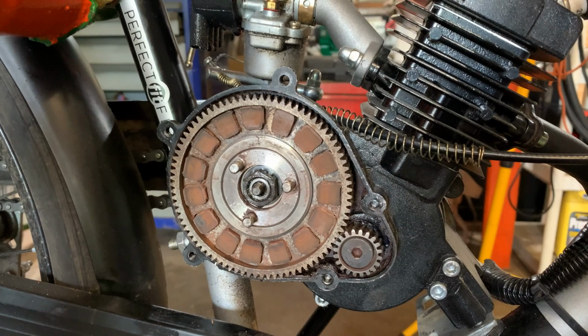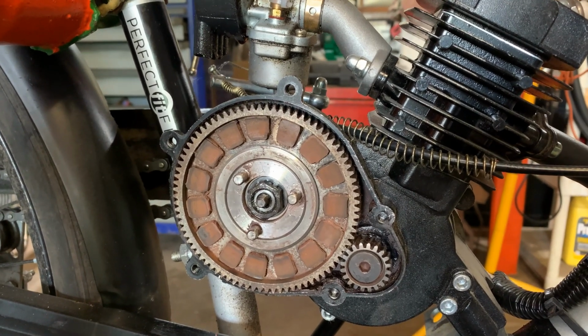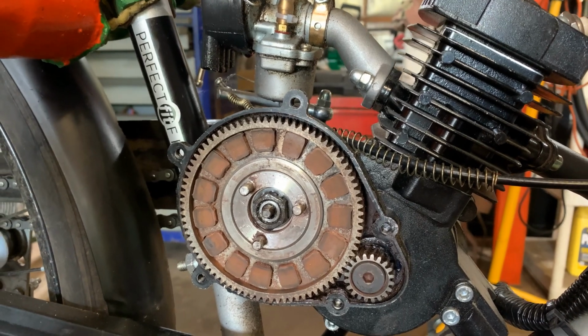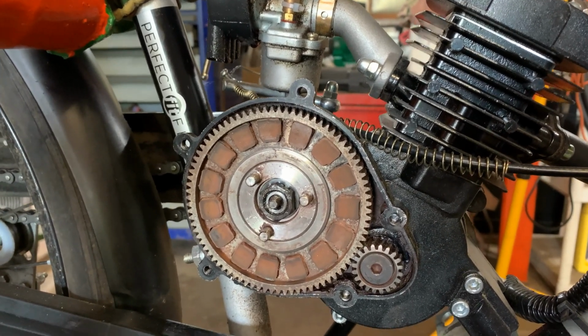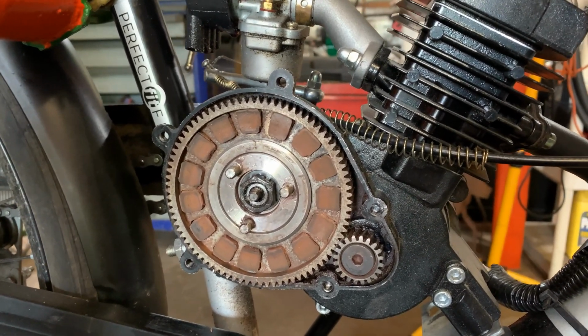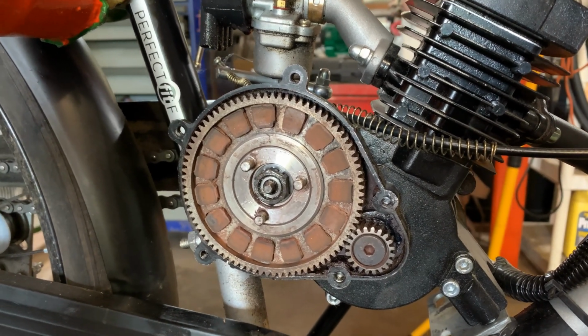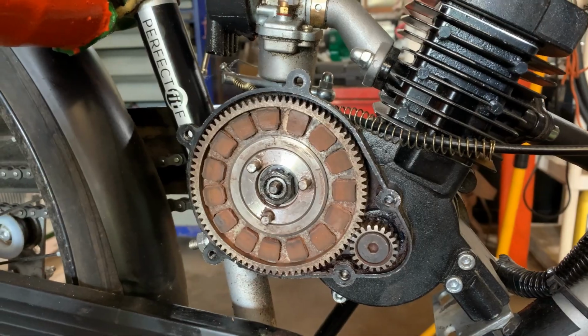That's what I refer to it, when it's already at top speed, and then for some reason people will squeeze the clutch thinking that gets more RPMs in the motor and lets it freewheel a little bit and then releases the clutch handle, and like that's going to take you any faster. All that's really doing is wearing out your clutch pads. Doesn't really get you any more speed.